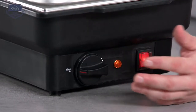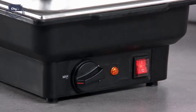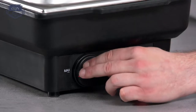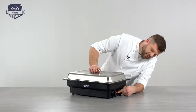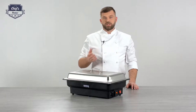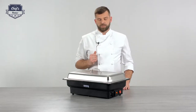For the initial heating, when you need to raise the temperature quickly, you just put it up to the maximum. But the device is not designed to work on maximum all the time, so you drop it down somewhere around half. There's also an indicator light which shows that the device is working and heating up. You'll see this light flashing during service, meaning the automated temperature control is switching the heating element on and off in order to keep that desired temperature level.